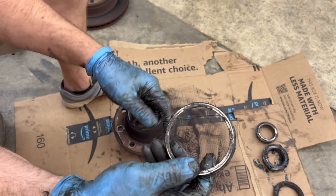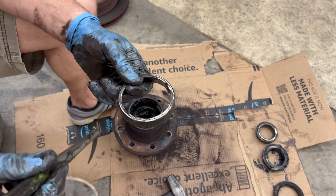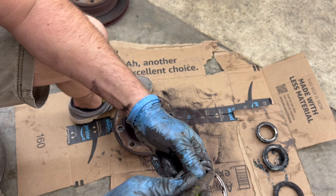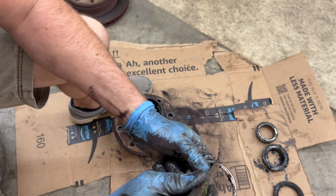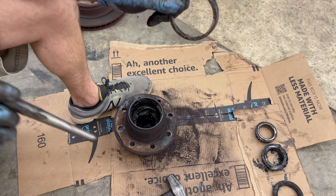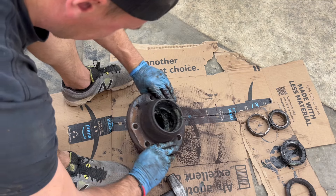So what I was doing just then — this is sitting down in the hub, and I'm just sitting on the edge of it like this, with this top portion against the hub. That gives you something stable to lean it against and drive it down. Work your way around — don't just stay in one spot — just like when you drive the new one in. So now we're going to flip this over and do our inner race.